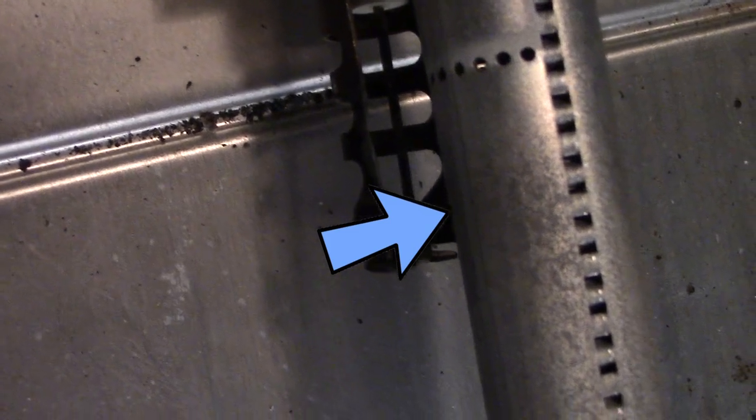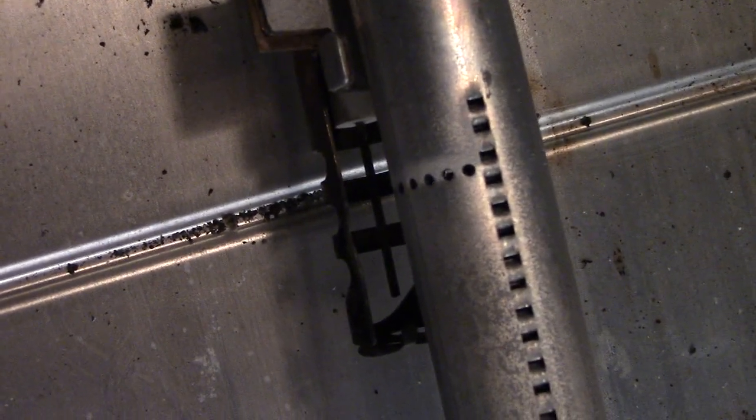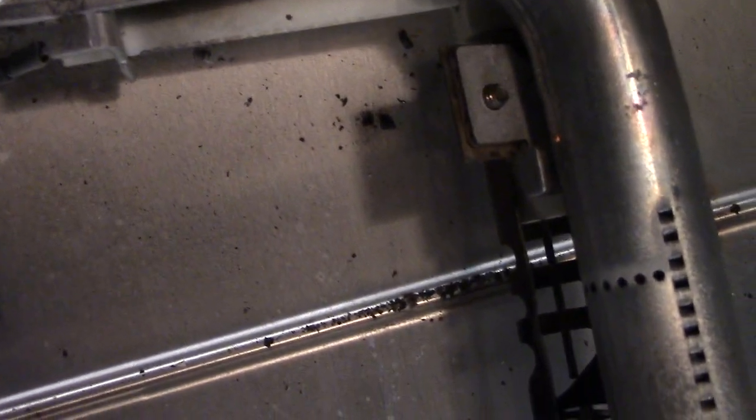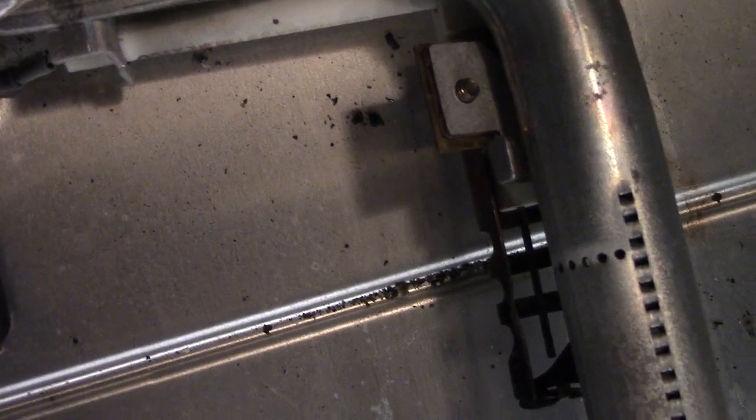Unrestricted. Also, make sure all these ports are open. Apparently someone mentioned there's a new updated model of this burner that will have more holes in it, so some people are just drilling holes in theirs to get better flow. You also want to make sure this little igniter is clean and clear. From what I read, this also transmits a signal back to the control board, which tells it that it's getting hot at the right temperature. So this doesn't just spark — it transmits back. I don't know exactly how that works, but let's clean this up and see if the oven works.